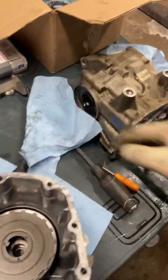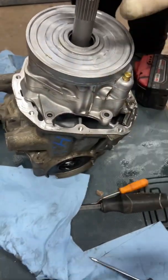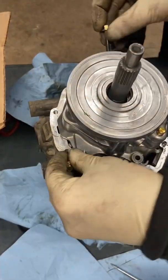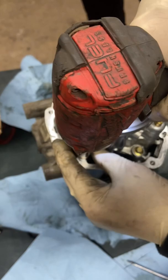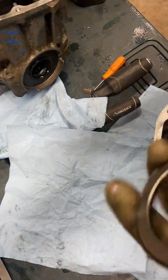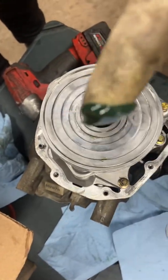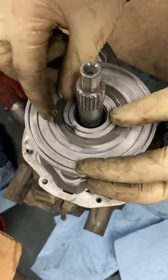So now what you want to do is pop the pump back on. I'm not torquing anything down right now because this is just for assembly purposes, but you put the three screws in here, pop them on, zip them down, torquing down — left side, whatever you want to do. And then you've got this washer here — you have the outside part and the inside part. This one faces up. This is what's going to be rubbing on here, so you want this done. What I like to do is put a little grease on here just to hold it — Honda grease, it doesn't matter. Put a little grease at this edge, this edge, put it on there. That should kind of hold it.